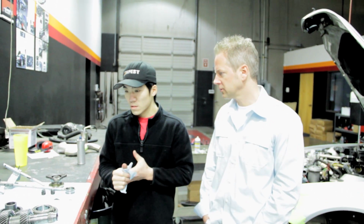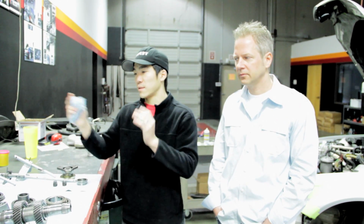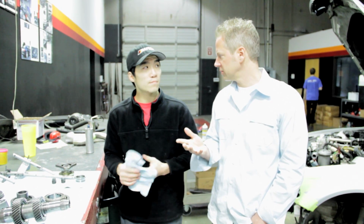A lot of the time it's caused by a clutch that's on its way out that the operator doesn't realize until a gear has been damaged. So how does this impact SMG transmissions? The same way. The SMG transmission, besides a few small differences, has exactly the same stuff in it. So the SMG transmission is doing the shifting just like we would, and it's trying to go into a gear with a synchro that's not working.